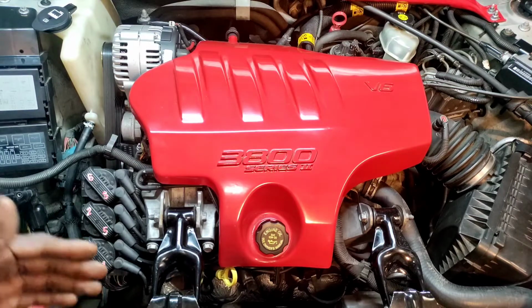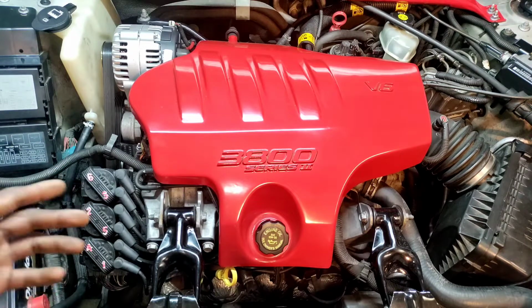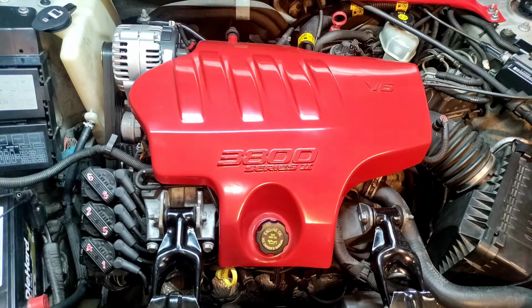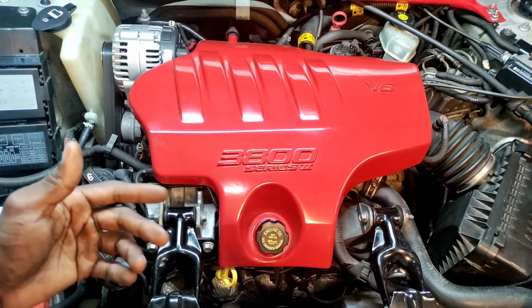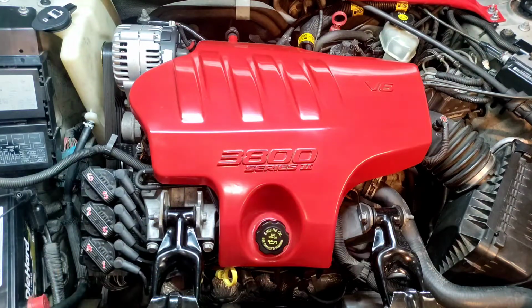Now, with the vehicle still incapable of cranking, we had signs of a running vehicle, but it legitimately was not capable of rotating and turning over. So once we heard the injectors, had the code, and the compressor activation, we started looking over some things, putting the context clues together, and overlooking some information. The vehicle had an RPM signal.